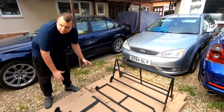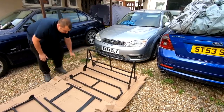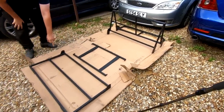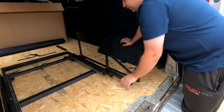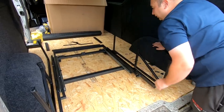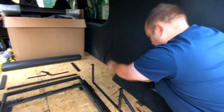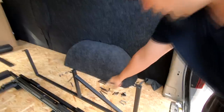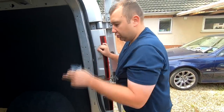The framework comes in two packages — one box for the frame and another for the cushions. In the frame box you've got your main back piece, your lower seat rest, the base that you screw into the floor, and your front seat. Inside the van we've laid out the two side rails and the main seat-bed part, which sits on runners so it slides in. There are two legs at the front — make sure the longer screw goes at the front of the vehicle. You also get a packet of miscellaneous bolts and a bag of wood screws for fixing the cushions to the frame.